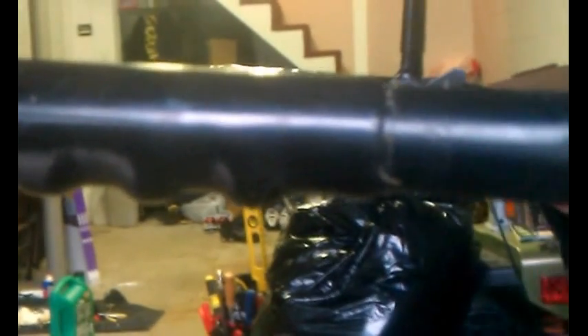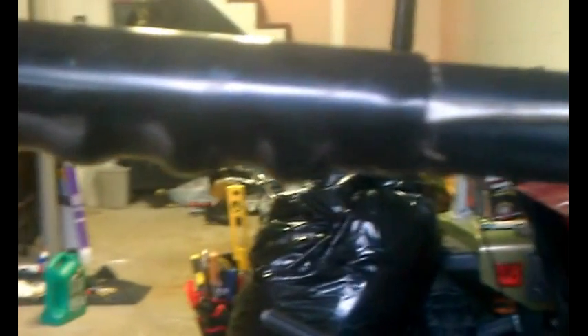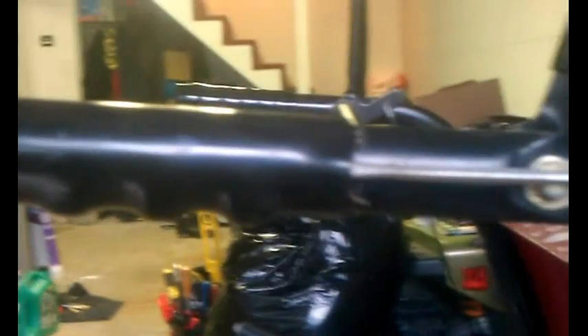In order to take these grips off — every snow blower is different — on this one it was glued right here. I used my knife and carved around it all the way around. It was only glued at the tip, and then I used a small flathead screwdriver, jammed it in there, and broke away the glue.